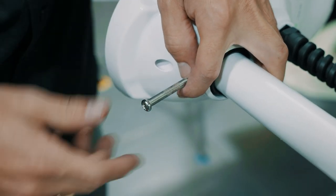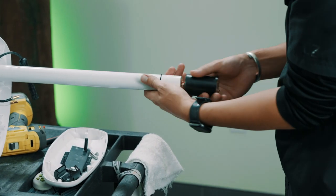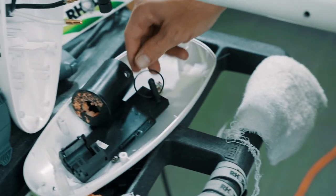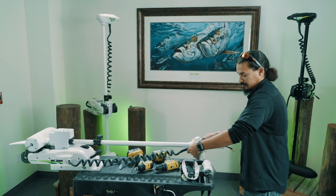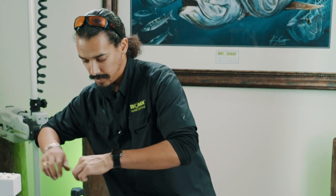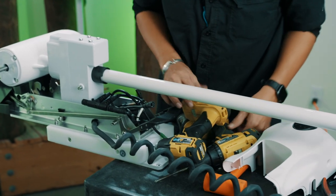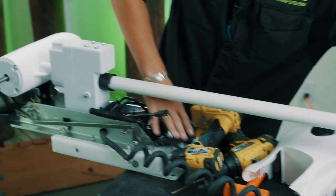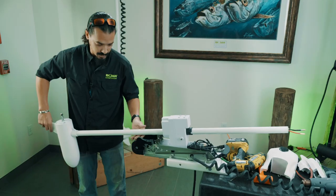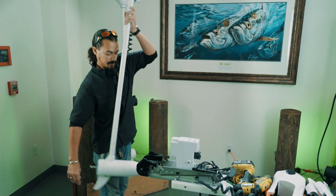It'll come right out and this will come down. Pull the head sleeve off — there's an O-ring; save that. Put everything on your lid so you don't misplace anything. Slide it off, take off the depth collar. It should be clear to pull the shaft out — just bring it out, it should slide right out. Set that aside.